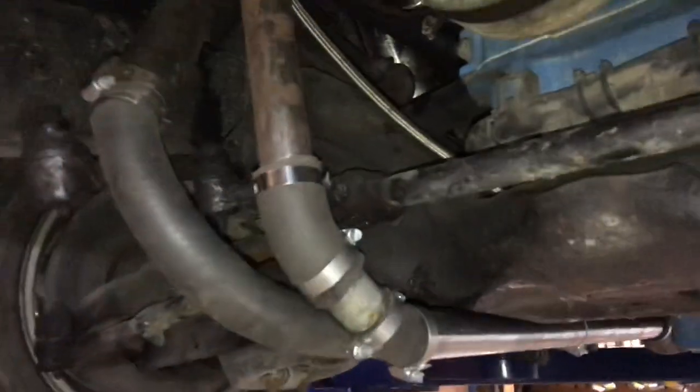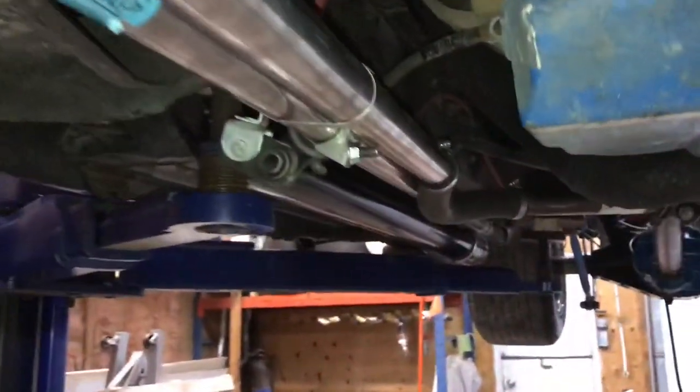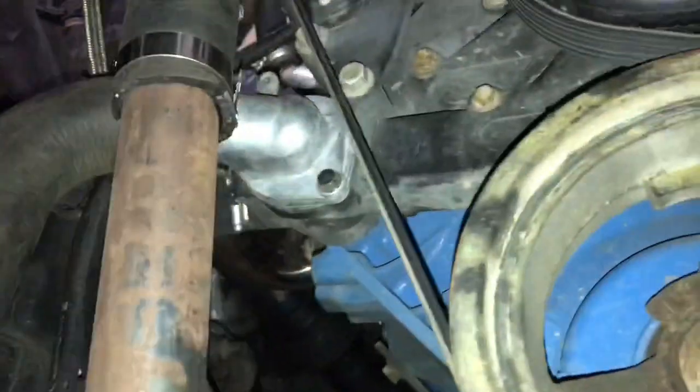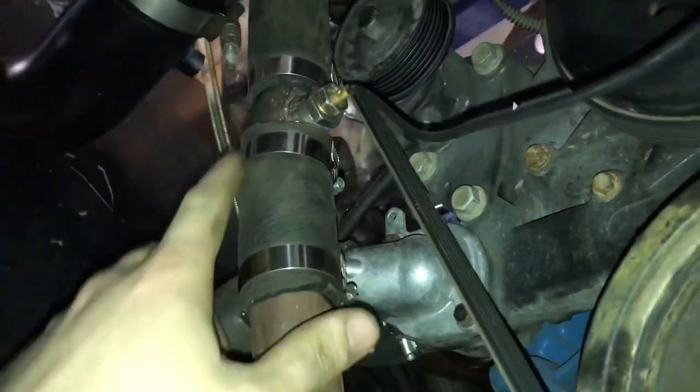So it seems like part one of this video is pretty well clued up. The pipe runs right from the water pump, down up to the frame, turns, goes across here, up into the radiator up here, flows across, out the bottom of the rad, right on up the frame rail, into the bottom of the water pump. And also my mechanical temperature sensor, I figured is a good spot right here to put it.